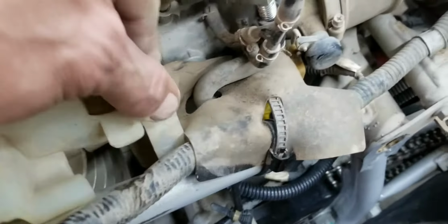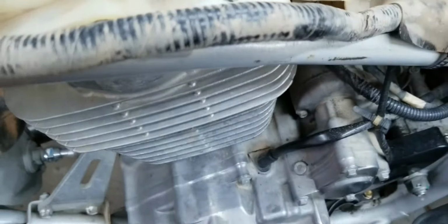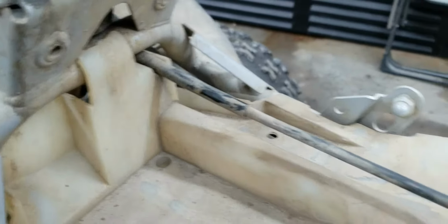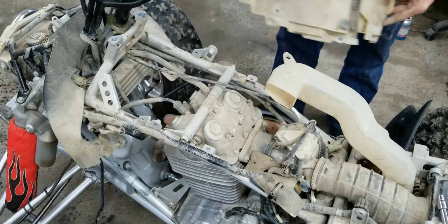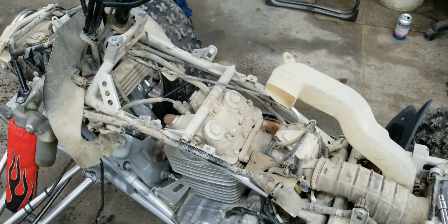Okay, when it goes back together, there's a little tab that goes underneath the frame, that one above the frame, and then this, your cable has a little slot right here, and it just sits right there. So that's your throttle cable, and so just remember that when you put it back together. Good luck. So that's really not in your way, and there. Congratulations, you got it done.